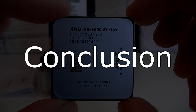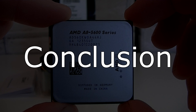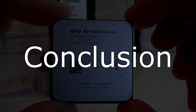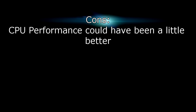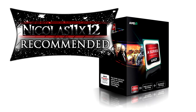In terms of CPU performance, there isn't much difference between the A10-5800K and this A8 model. At idle, the A8-5600K was able to beat the i3-3220 in power consumption, but once the machine is under load, Intel still wins. Overall, I think this APU is pretty good, and you have to choose whether you go with Intel's Core i3 or AMD's A8-5600K. Pros: good price-to-performance ratio, amazing GPU performance with the HD 7560D, low temperatures, support for high-frequency memory, and an unlocked multiplier for easy overclocking. For the cons, I can only say the CPU performance could have been a little better. Other than that, I give this APU a 9 out of 10 and would definitely recommend it. Thanks for watching, and don't forget to subscribe!